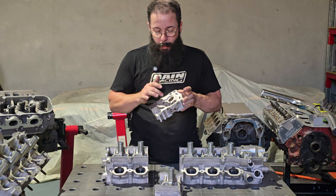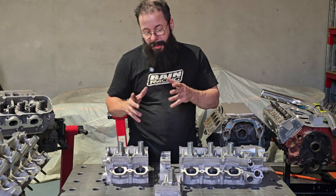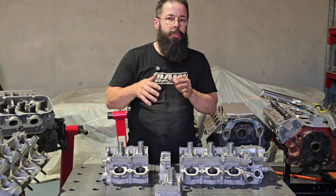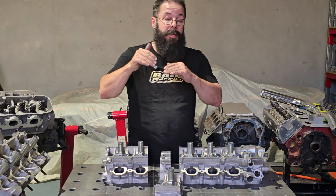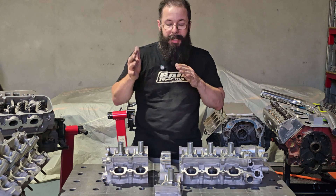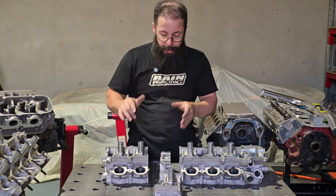So we're not going to delete it — we're just going to try and improve it, because we don't want to chase ignition timing. With RBs, a lot of people pull the quench pad right out. I'm guilty of that too, but it is more of a fueling issue when we do it. You'll see how it extends the ignition timing needed — meaning we need more timing before TDC — so we have rising pressures working against us. The longer the burn period, the more chance we've got of pre-ignition and knocking.